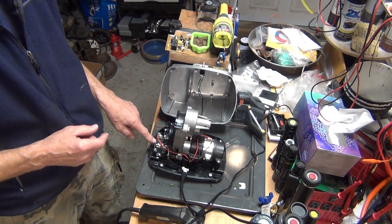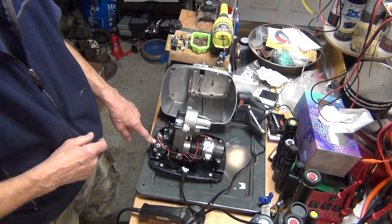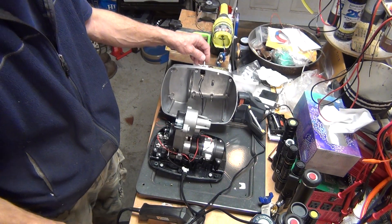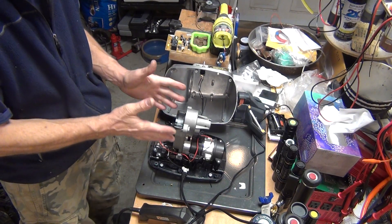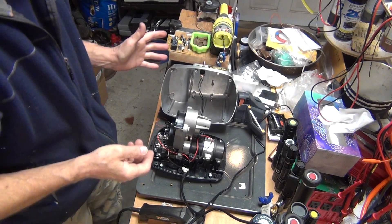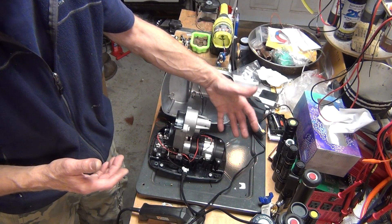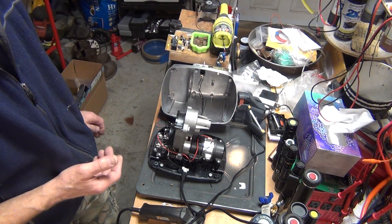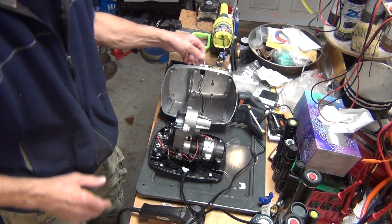So I got myself a pretty heavy-duty rectifier — it's a 100 amp rectifier right here. I took out the original board, took out the switch (it was a low-voltage switch), and I installed a 125 or 250 volt switch. With the rectifier in place, the puppy is ready to go. It was a big bummer finding out it's a DC motor when I opened it — kind of a disappointment — but the rectifier solved the problem. Check it out.